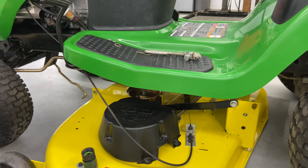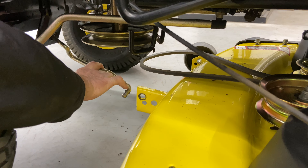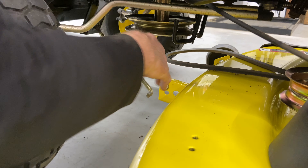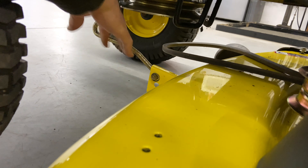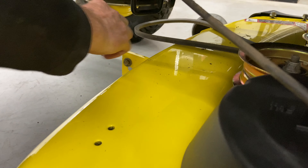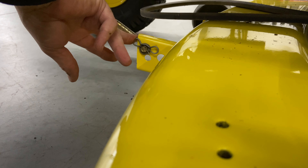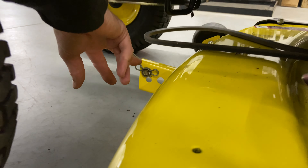At this point, I normally start with the front rod. I took it off first, so I'll put it on first when I put the mower deck back on again — it just makes it easier. So I either rock the machine back to the mower deck, or you can bring the mower deck to the rod. Slide that in, put your washer on, and then your pin. I always face the pins rearward, just in case you hit something and they don't pop out — if you have them reversed, they can pop out. These are really good clips that usually don't pop out.